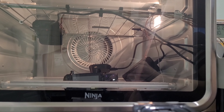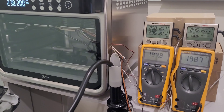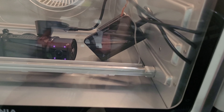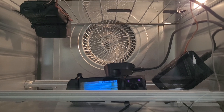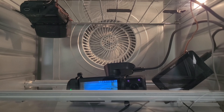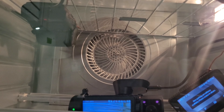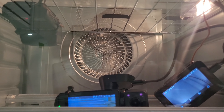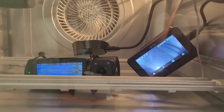All three units are still going. The AA-10 turned off at approximately 194 to 198 degrees, with a cabinet temperature of 200 degrees. The unit is officially off with no more green light. The temperature inside the car is too high and the dash cam will be turned off to avoid damage to the device. Although the U3000 did turn off, it did wake up in energy saving mode to still record — that's a plus. The AA-10 also shut off but turned back on into parking mode after cooling down.